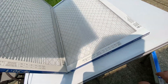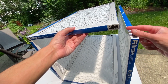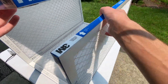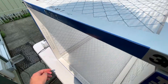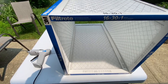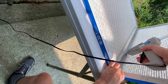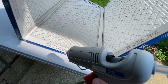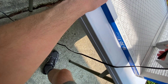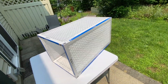Support the top filter as you do this. Take your next filter and glue it on the right, resting it on the table with the airflow arrow pointing left — same as always. I'm sorry if I sound redundant, but approaching it methodically is actually the least work and yields the best final product. Use your fingers to make sure it's flush on both sides, press it for a minute, then hot glue the crack. Rotate clockwise again, put hot glue on that vertically oriented filter, and you'll find it naturally rests against the table like all the others. You now have a square box. If you don't follow this method, you may end up with a rectangular box instead. And there it is — the final product.